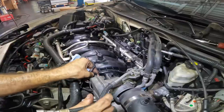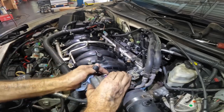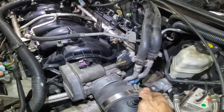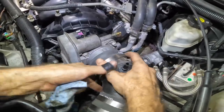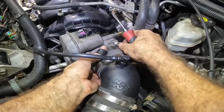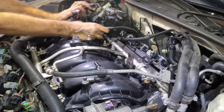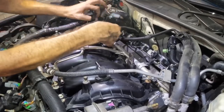Let's plug some stuff in real quick — the easy to forget stuff. That one goes there. Throttle body, you go right there. Clickage. We'll get that fuel line later. Still have to get that one that's in the corner — that was a tough one to get out. Let's do that one by hand, same way it came out. Quarter turn at a time.